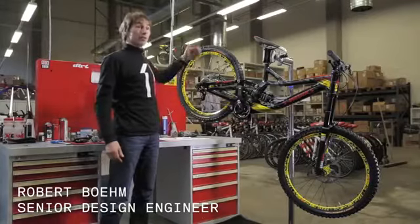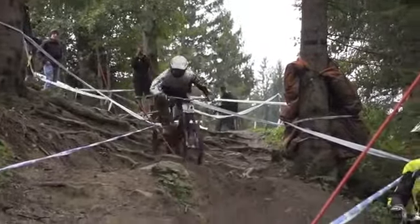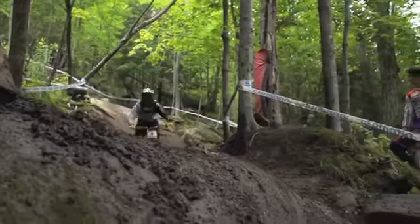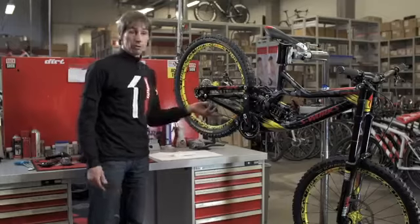These bikes have a lot of suspension, and while you ride through the terrain it might feel like a very smooth ride because you've got a lot of suspension, but actually there's a lot of things happening on the rear wheel, as it moves very fast up and down. That leads to chain slapping, leads to losing control of the chain.